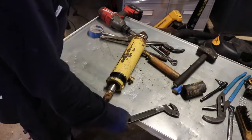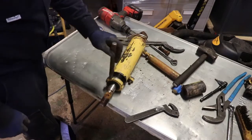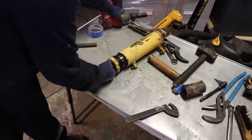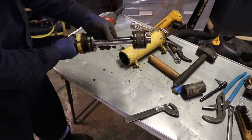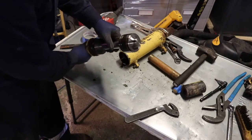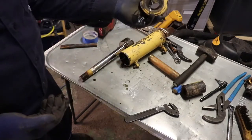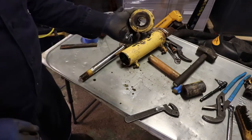I used the spanner wrench for a bit but it was chipping the edge of the cylinder, so I just used a wide chisel and pounded it a couple of times and got it to move. Now there's two parts - you've got your cylinder, then you've got the packing. It's a double-acting cylinder so it has the opposite on each end. No fastener on the end, so I have to pry those off. Looks like it's got a couple layers of stuff in there and a snap ring fossilized in here as well.